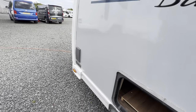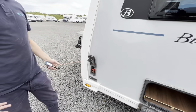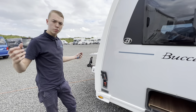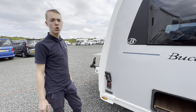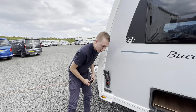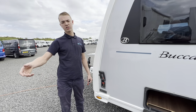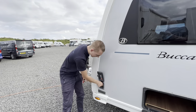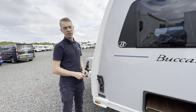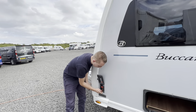And there's a little bit of storage under there. At the front you've got an external gas point, so if you're using a Cadac or external barbecue, you'll need a length of orange gas rubber hosing, two jubilee clips, and a quick release connector. The quick release connector goes into here. You'll need a jubilee clip to connect the hose to the quick release connector, and a jubilee clip to connect the Cadac or barbecue to the hose. Then you can turn it on here and it'll use the bottles from the front of the caravan to power this instead of carrying a spare bottle. All you need to do is turn on your gas tap to allow the gas to come through to this point.